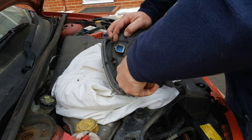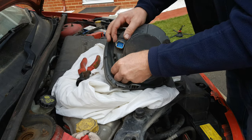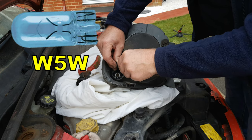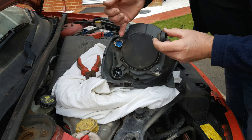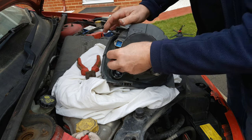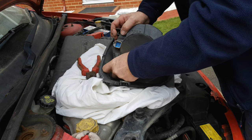With the light unit still on its back, pull this rubber cover — which I found completely impossible to do with my fingers — and that reveals the W5W sidelight bulb, which is a simple push fit into that hole. This grommet has a groove around it that locates on the edge in the hole. I find it easier to push it in from the back.